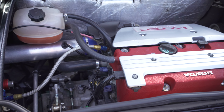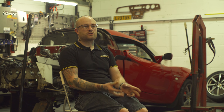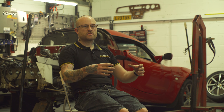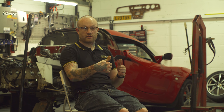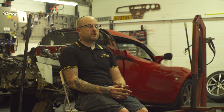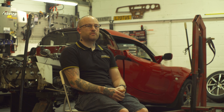The process of doing a Honda conversion: we strip out every engine, gearbox, cables — the whole drivetrain gets removed. There are slight modifications to the near side and off side engine mounts on the chassis and to the rear subframe, to allow the engine to sit slightly further back than other conversions, so we get less angle on our drive shafts when fitted with our kit. Honda ECU, full new wiring loom. It's advised, depending on the age of the car, to upgrade your fuel pump — especially if you're going supercharged. You might want a high rate fuel pump or a secondary fuel pump, swirl pots.